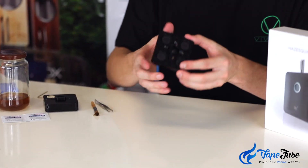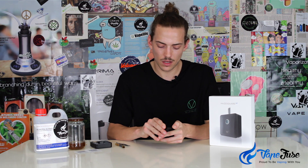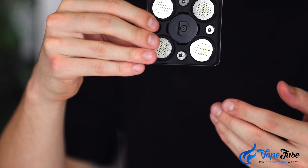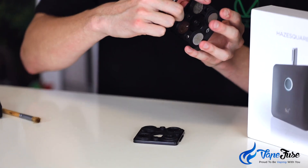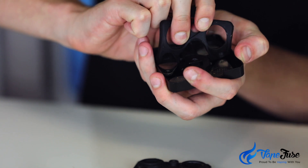You can put the heating element and battery aside, get rid of the allen key, and what I'm going to need is just the hub chamber. Giving this thing a detailed clean on a weekly basis is really necessary. The Haze in particular, although it is a full convection vaporizer, has combusted on me on a number of occasions simply due to not cleaning. If you're not going to clean and maintain this thing, these tiny little holes in the stainless steel screens at the top of the chamber just become caked with resin, and that prevents the chamber from circulating air properly — it just results in combustion. Haze does have an optional filling tool that also helps to maintain and clean the device, but it is not included in the kit.